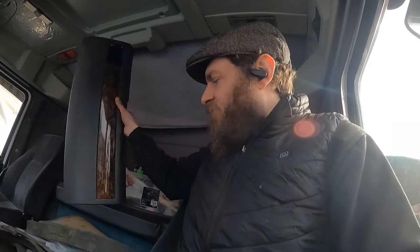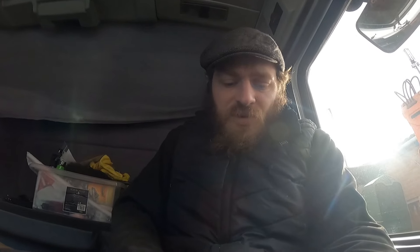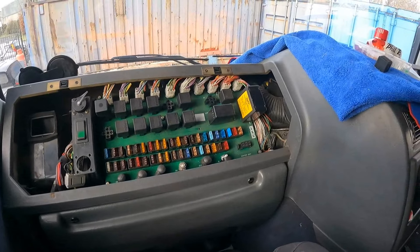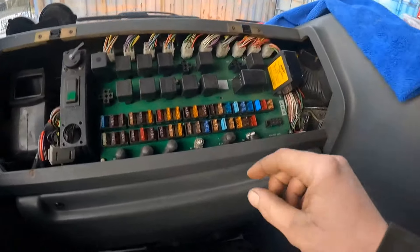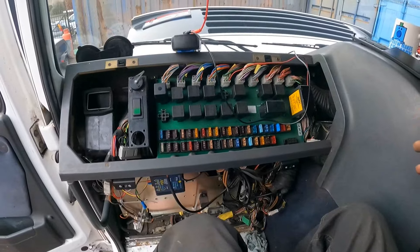I'm trying to find a set of steers and I really need to have a look at the ABS fault. Fuse panel off - F30 is switch to positive ABS and it's a 5 amp fuse. I went through the fuses previously and found a load were wrong - where it should have 5 amp fuses it had 15s, and 7.5s had 10s. Let's get the correct fuse in. Just tried turning the ignition on with the relay unplugged and it went pop straight away. We need to find out why she's fusing.